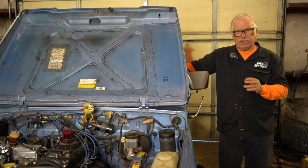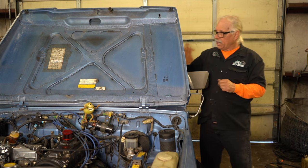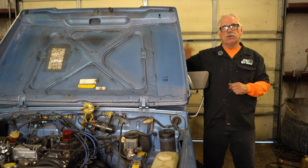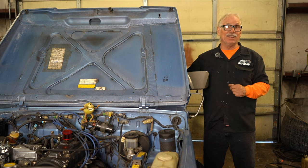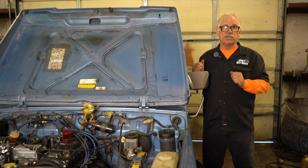Now today we want to adjust a mechanical steering box on a Suzuki. How do we do that? First thing is we put our hand on the top of the steering wheel and we want to know: does the wheel move if we move it one inch? Two inches? I think I see it at three inches. We don't want to have to move the steering wheel three inches before the tire turns.